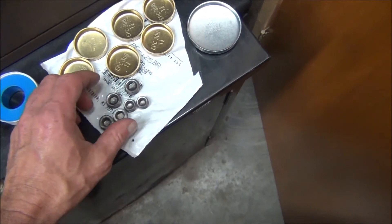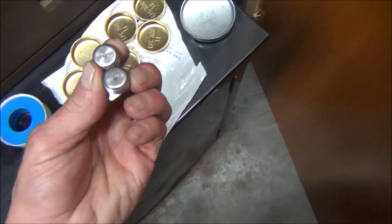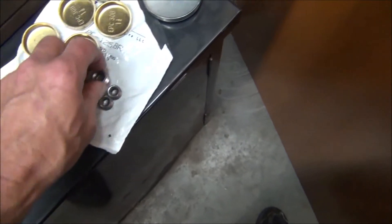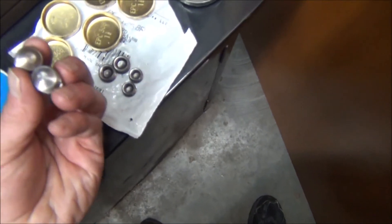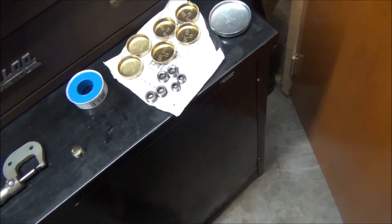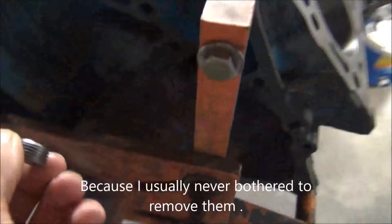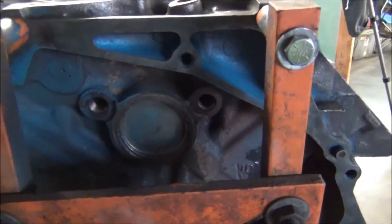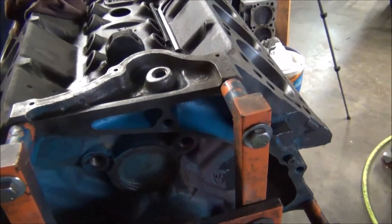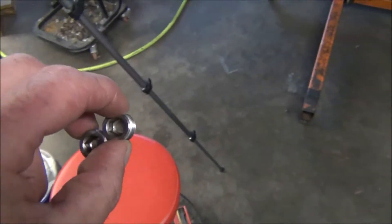Here's what the new oil galley plug kit looks like. Two of these screw into the back. These two flat ones — you can see these two are flat on the back — and these two have a taper. I didn't know much about which ones were which, I had to look it up. The two flat ones go in the rear of the engine, and all they do is block off these two galleys so oil doesn't pour out and you'll lose oil pressure when the engine's running.